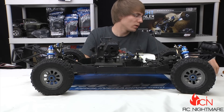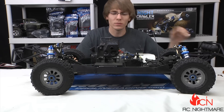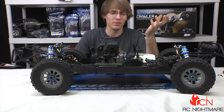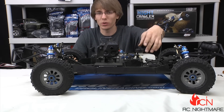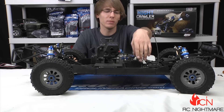You don't have a solid link between your servo and your brake links — it's just soaking up a lot of the torque. So we did a real simple mod: we grabbed a couple of Traxxas Jato tie rods and a few bits of hardware — some 20-odd millimeter screws. The total parts cost is maybe eight bucks altogether and we've made stiffeners, essentially torque arms, that go between the servo and that brake bracket so you don't have any slop.